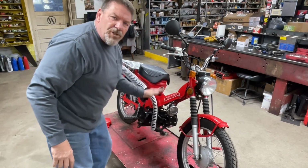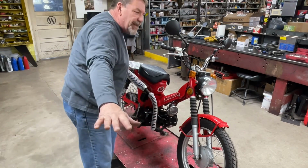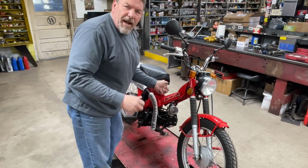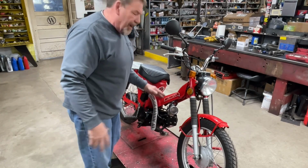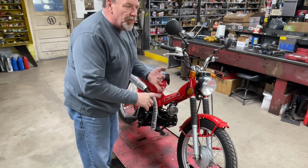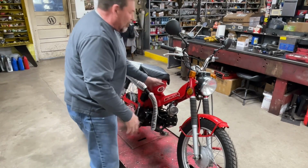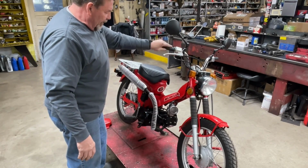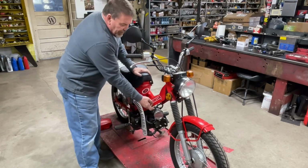I tell you, other than adjusting that idle, these 22 millimeter Nibbis, I've never made an adjustment to them. I've never changed the jet. I've never changed any kind of setting for air-fuel mixture. I've bolted them on, and away they've gone with these 125s. Every single bike, the yellow SL70, my clone Amigo Rocky bike, that S65, every time I've ever used one of these, just like what you just saw, bolt it on, go. Bam. And it's so much easier to access right here.